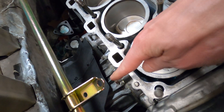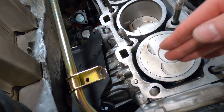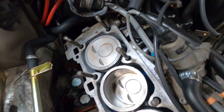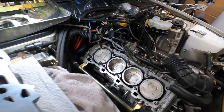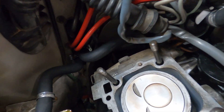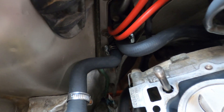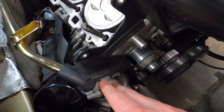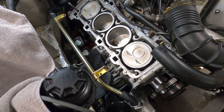It's also making a little loop through the oil cooler housing to cool down the oil — going in and coming back out through the block. In the back of the system, there is a flange on the cylinder head which supplies fluid through the heater control valve and into the cabin underneath the dash, through the heat exchanger, and empties through the heater return pipe back through the water pump — doing another loop that way to heat the car.